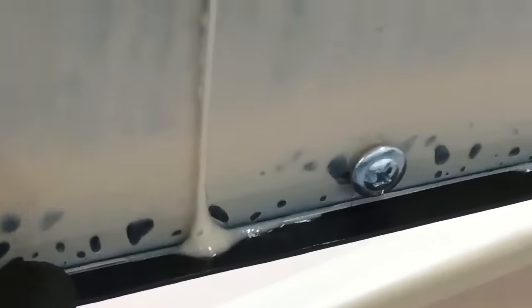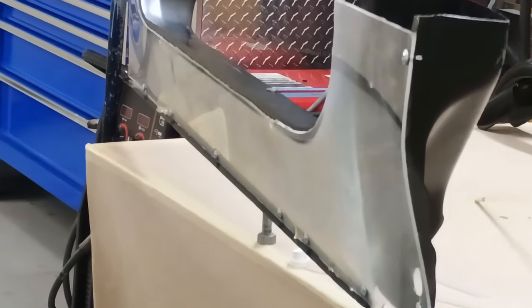Okay, so that was our second coat. And where the rust usually starts, man, that's got a lot of buildup there. Now, the thing about this wax is it is self-healing, and it wicks in between the body panels to give you total sealing. Yeah, I don't really know anything else that can do that or that does that. And now we want to do this after we've done all of our metal work. So let's open this thing up and see what we've got.